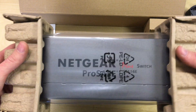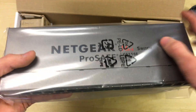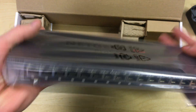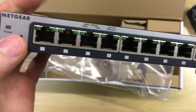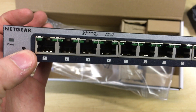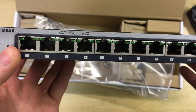In the box itself you've got the switch — it's in a grey finish, all metal, heavy-duty construction as most Netgear devices are. On the unit itself there's a power indicator LED, and a factory defaults button which you'll have to push with a pin or pen. That will completely reset any changes and configuration you've made, taking it back to factory settings — it also clears any passwords and IP address changes.